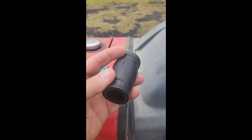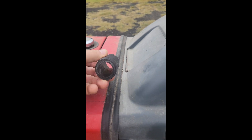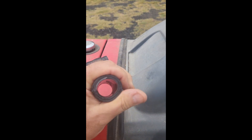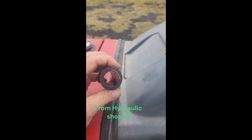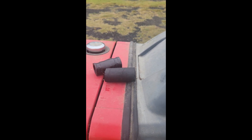It's the next day. I went and got the hoses - unfortunately I went ahead and put the hose on without filming it. Looking at the original hose, it has a smaller side and a bigger side. I got a hose matching the smaller side and then a hose for the bigger side. Since the rubber was really hard, I figured I had more chance clamping down a bigger hose and squeezing it than stretching it wider to fit the bigger pipe, so I went with the bigger hose and clamped it down and it worked pretty good.